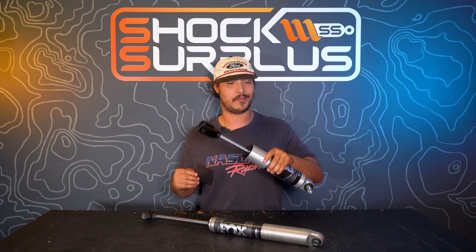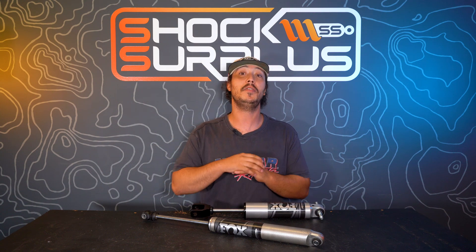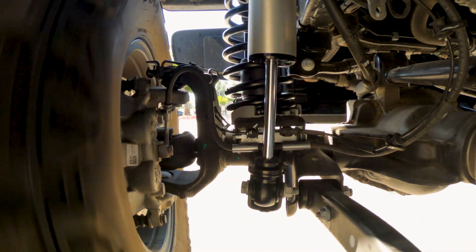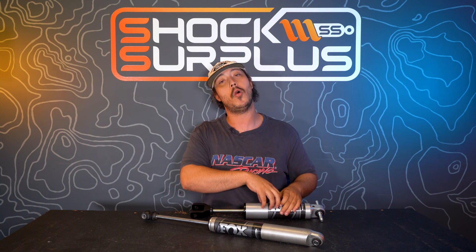Having this hydraulic top-out zone is going to be a big benefit off-road, where your heavy solid axle wants to extend the suspension, top out hard, and make you nose-dive the front or back end. Being able to control rebound that last little bit gives you top-out control to keep the vehicle much more stable without sacrificing traction in the normal ride zone. Rebound is a big factor for handling balance and how weight is shifted throughout the chassis, so they're only adding a little extra control at the end of the stroke where you need it most.